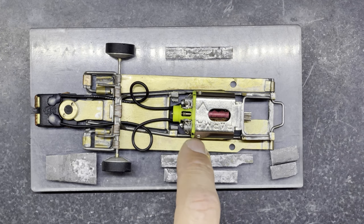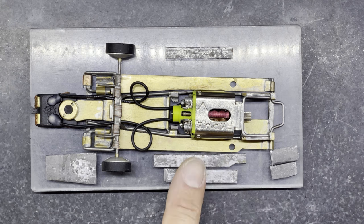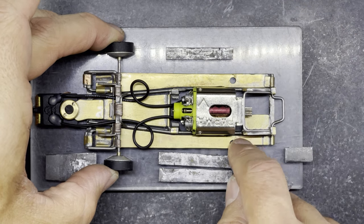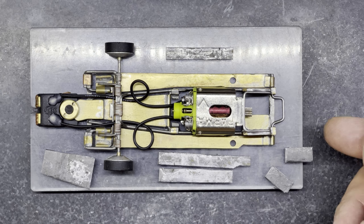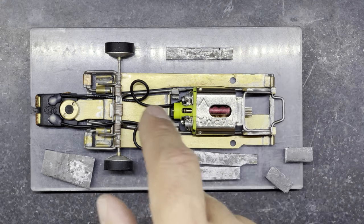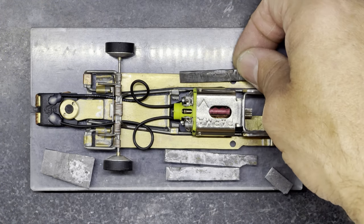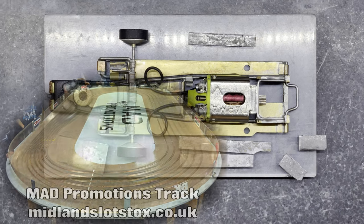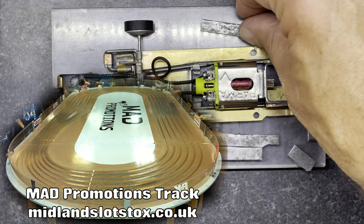There's also a weight going on the bottom pan section here on the inside by the motor, to weight it towards the rear. Now remember this section of the car is movable front to back. Any weight on this pan section is going to shift forward when you brake or hit something, and shift back when something hits you or when you're accelerating. So this weight will actually give you a bit more grip towards the rear, or a bit more front-end plantedness when you actually hit somebody. For the same reason I'm going to put a little bit of weight on that side of the pan as well, since the cars are generally only turning left.